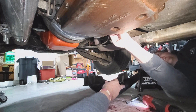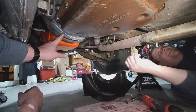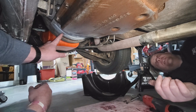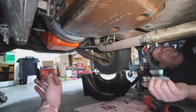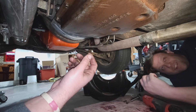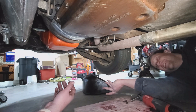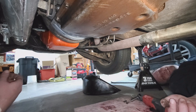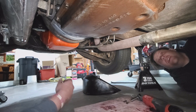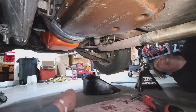I don't think it fit right with that new torque converter - I think that's why. We did put a different torque converter in this car and it's still not correct. This car came with a 1400 stall, this is an 1800. The conditions have to be perfect for this car to do a burnout - wet concrete, cold tires, freshly started engine, gravel dust helps. This cam doesn't make power until 2500 RPM and the engine is a little tired.